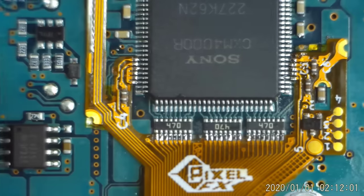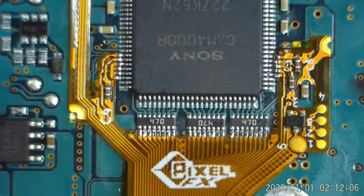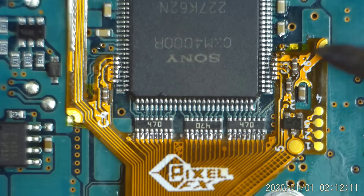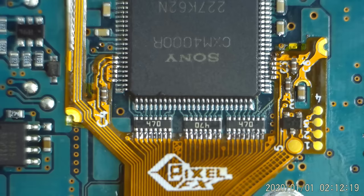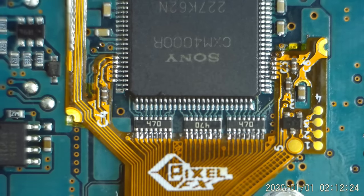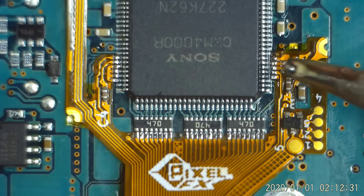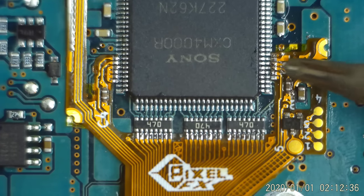You really have to mix thoroughly if you're going to go with leaded solder, because otherwise cracks can form with thermal expansion over time and your solder joints will break. As long as you mix, you should be totally fine. There is one thing I did here which was a mistake: I was working on the right side of the chip and accidentally desoldered one of those ceramic capacitors on the flex cable itself. So if you're doing this install, just be mindful when working on this side that you don't accidentally swipe off that cap. Thankfully I was able to find it and reattach it off camera, so it wasn't the biggest deal.